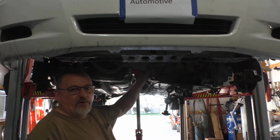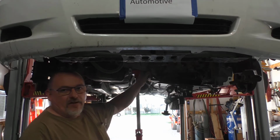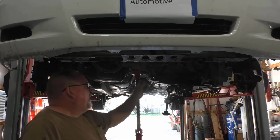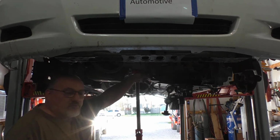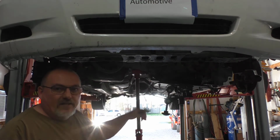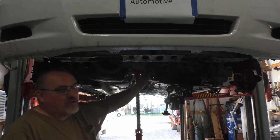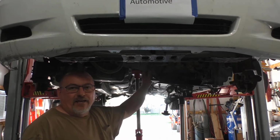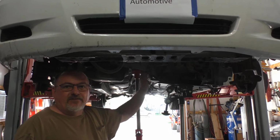It's easy. When you're pulling it in, stick your finger in there. If the torque converter rolls, it rolls. I mean, it's as simple as, if this torque converter here rolls when you're pulling that transmission in, it rolls. I always check. I always put my fingers in there and, okay, it's rolling. It's rolling good.